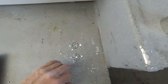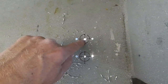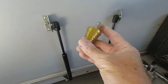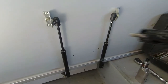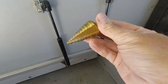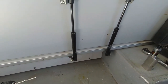I've drilled the four mounting holes, here's the fuel inlet, and I started pilot holes for the two larger ones. I've got one of these step drill bits — I have a one-inch bore but it looks like it needs to be about an inch and an eighth, so I'm going to go at it with the step bit. It's pretty aggressive. Within a few minutes I should be able to mount this thing right in there — I am super excited that I finally figured out where to mount this.